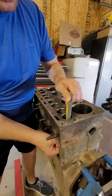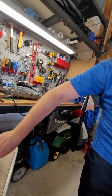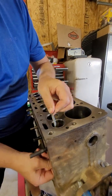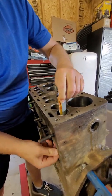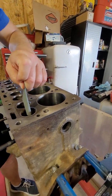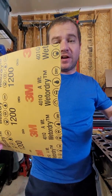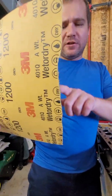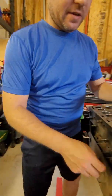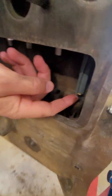The way I'm going to clean this — I've taken a piece of 1200 grit sandpaper. 1200 is probably a little bit light, but I don't really want to cause any changes to the geometry here. I just tore a long strip of this off — what I used to call hot dog style as a kid — and then I threaded it through, going all the way through the bottom.